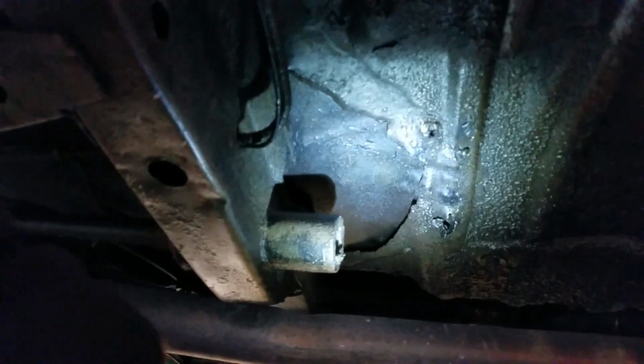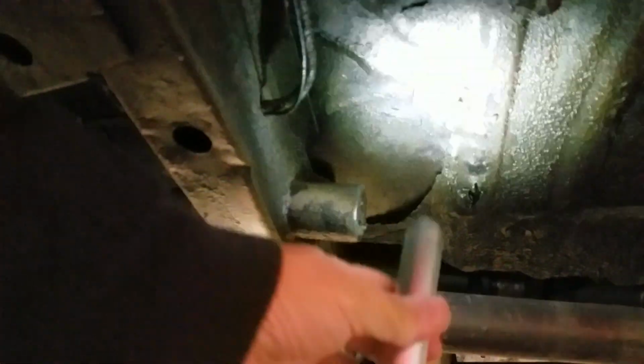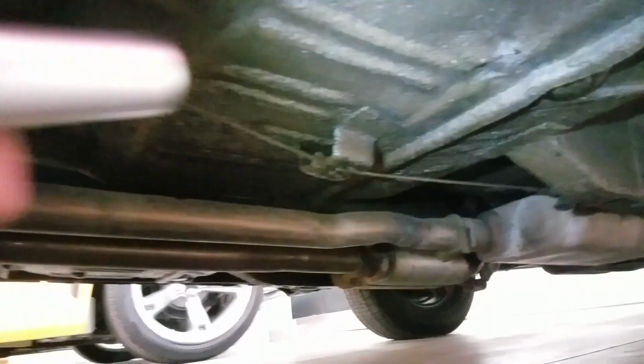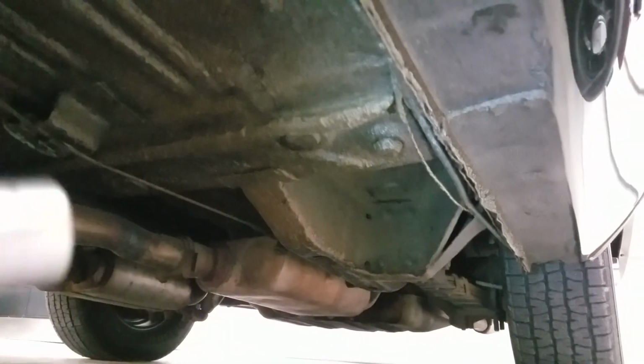Getting up under the vehicle. Again, duplicate description on the unitized frame rails. Torque box in the rear. Up here we have a cutout in the floor pan. Section was removed there, and a piece of tin dropped in. Structurally, I tapped on that here and there, and it doesn't seem to be presenting any big challenges, but you can see that they cut it right there and up ahead of this cross support. So other than that, the underbody is stout and really nice.